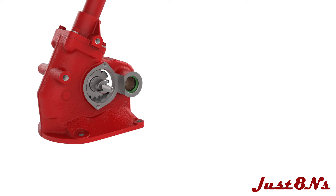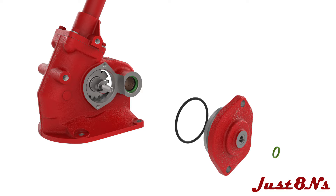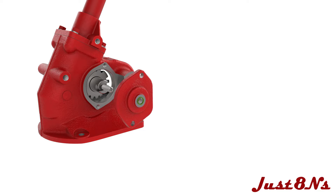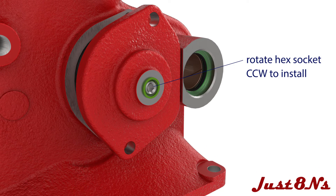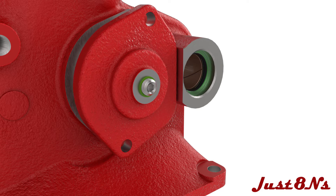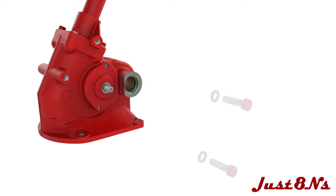Now assemble the sector shaft cover. First, insert a bushing into the cover, followed by an O-ring gasket placed in the circular groove, then place the adjuster packing in the boss on the outside face. The sector cover is installed by mating the threaded hole in the cover with the adjuster screw, then inserting a hex wrench into the screw and rotating the screw until the threads are engaged and the cover face is pulled onto the mating housing face. Do not tighten the adjuster screw at this point as the gear lash will be adjusted later. Bolt the cover to the housing with two bolt and lock washer assemblies. Place a hex nut and washer on the adjuster screw but leave them loose for now.